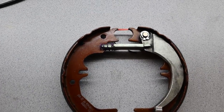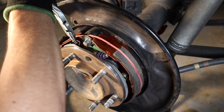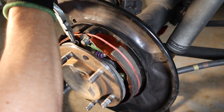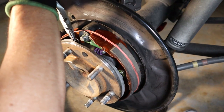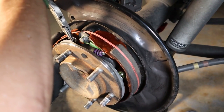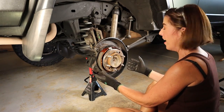I've got the bar with the purple spring into its own slot. Here's a cheat I figured out along the way: if you have a big thick rubber band, go ahead and put it around both shoes — that'll help while you're trying to put the spring back on the pivot point.